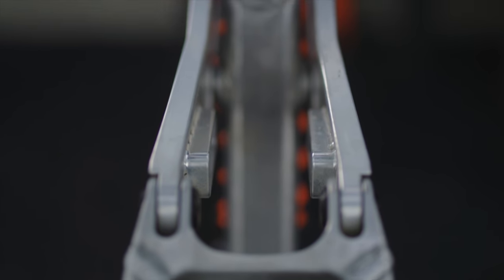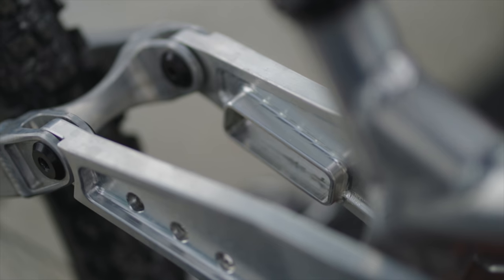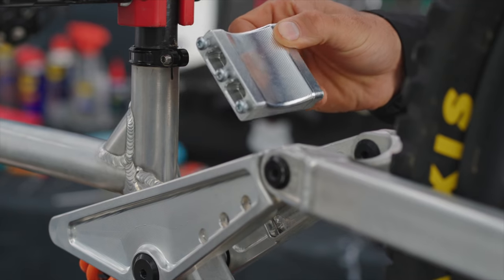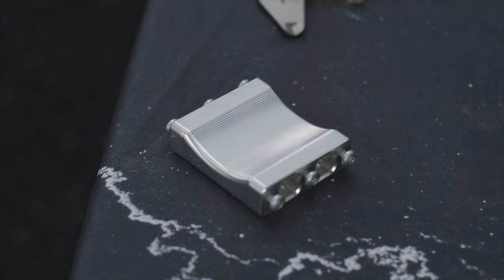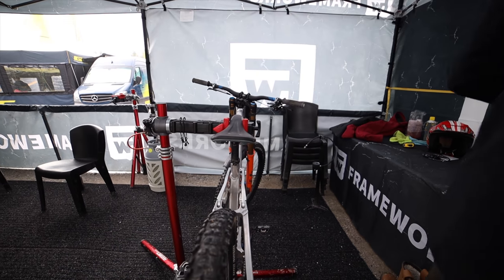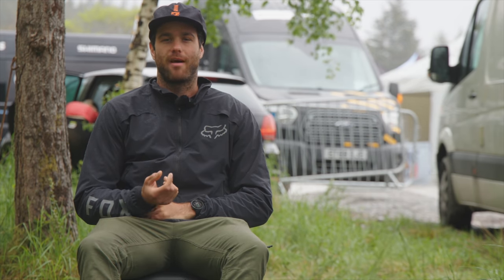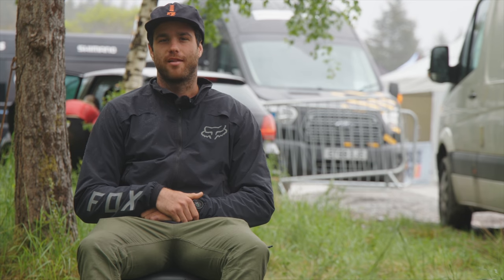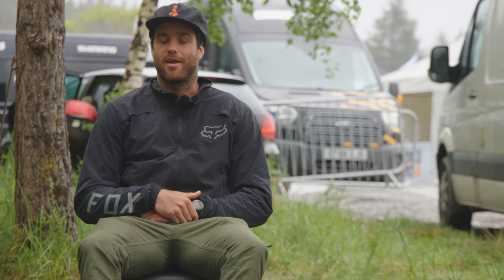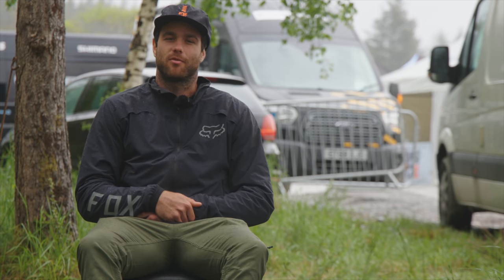I've also been experimenting with taking the brace out of the link. We had our link design with a bolt-in brace so I could take it out easily and try it both ways, and I noticed a big difference taking it out. The bike feels more compliant — it flexes consistently axle to axle and doesn't really have a hinge, so I feel like it helps the rear wheel grip the ground a little better. Initially I thought we needed the brace to avoid bending shock bolts, but shortening that bolt and using a grade 12.9 steel bolt designed for a bike with a long shoulder, I haven't had any issues with the shock bolt, both with and without the brace. Time will tell if we need to make more changes, but for now I just want to keep riding this bike and see how it goes.